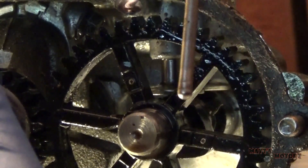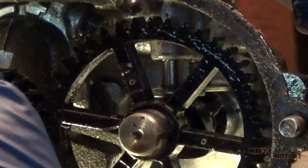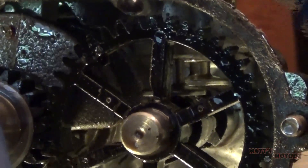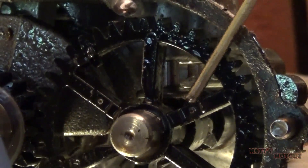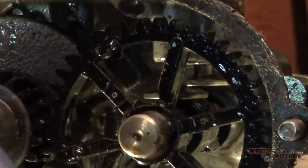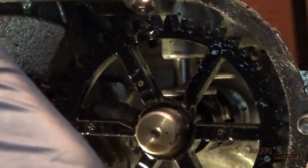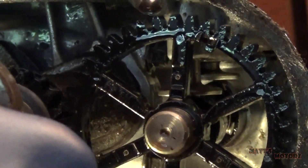I'm going to be pushing down the valves on top at the push rod. This is an overhead valve engine, so this engine will turn to the left. Right now it's at top dead center compression stroke — the spark plug would fire, going into the power stroke, and the piston comes down. None of the valves are opening. You can see the camshaft right here; it has two lobes and each lobe pushes on a plunger. As the piston starts coming up, it pushes up that back plunger, which controls the exhaust valve — pushing out the exhaust as the piston comes up.